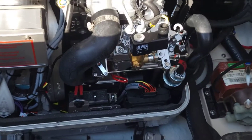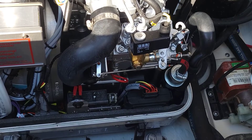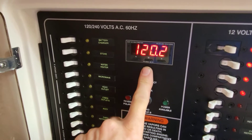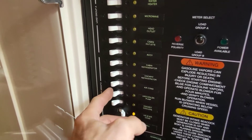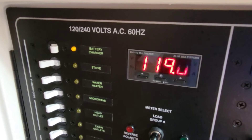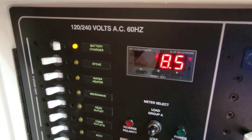All right, now you can see we're running — we're at 120 volts. Let's put a load on it to make sure that boost board does what it's supposed to. Put the AC on — that'll always help. Now watch this: you should see it go down a little bit, then come back up — that's the boost board working, always hunting for that 120 volts. Yeah, it's just 115 to 119 — see, it kicked in those two extra capacitors when it did that. That's the AC pulling heavy amps out of it.